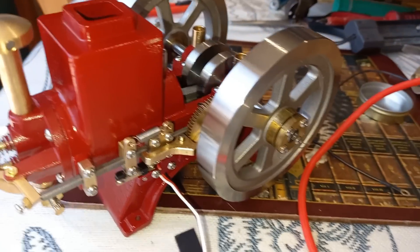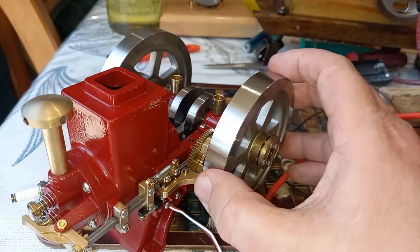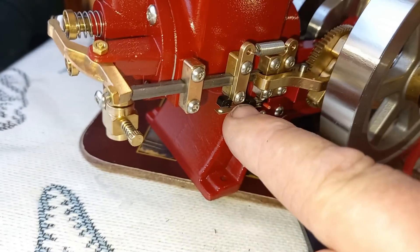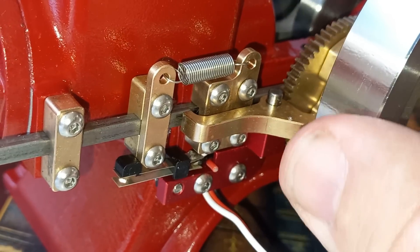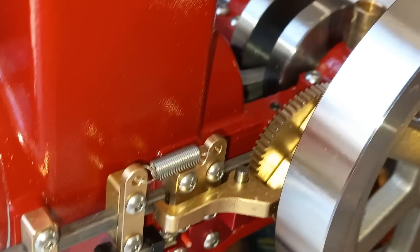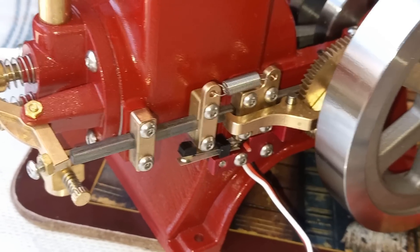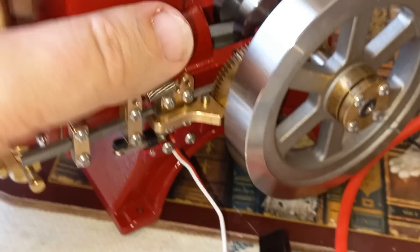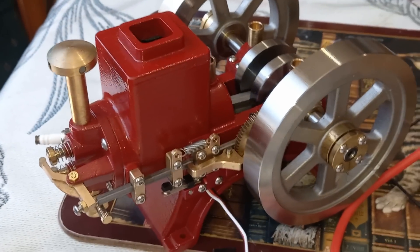I think it's a really good idea to make yourself familiar with how and when this fires based on the little switch down here. The reason it's a good idea to make a video of when that fires — which is just at top dead center — is that if some of these things are loose and after you've run it a couple of times it gets itself out of tune, you want to be able to put it back with confidence. So make yourself a video of where everything is before you rip into it.